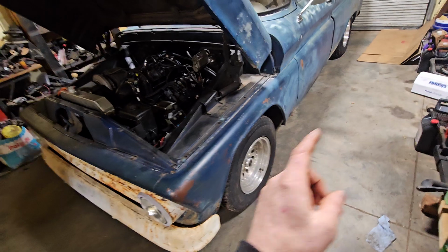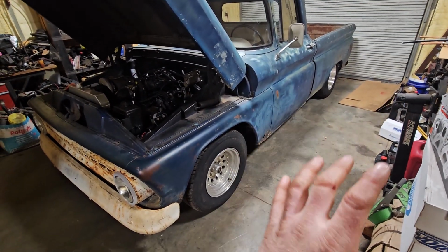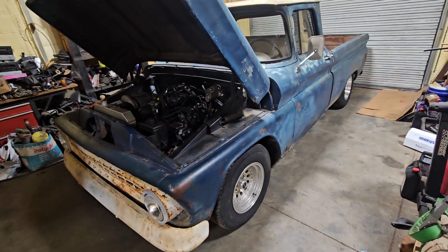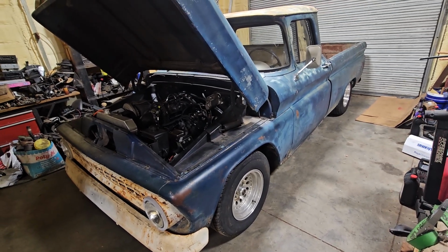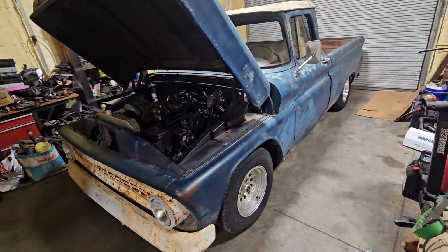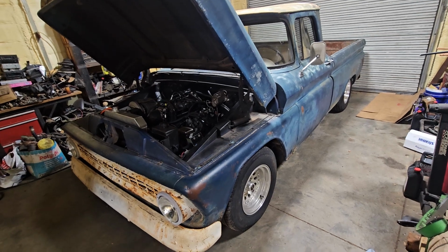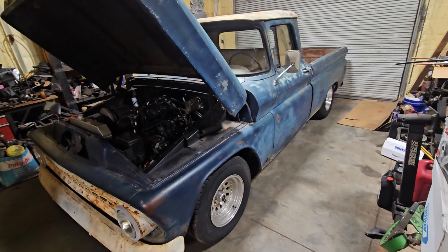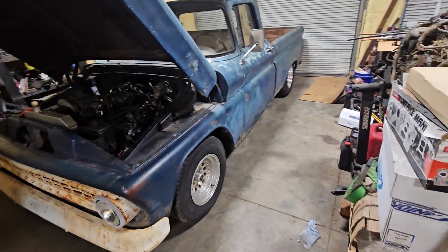So that was the other thing I had to do, was in measuring for the length at where I was going to be at ride height, and then you want to get as much extension as you can. You want to run the longest shock as you can, and then you want it about 60% compressed or whatever. So I did all the numbers and calculated it out and picked that height coilover. Oh, and the other thing was the angle.